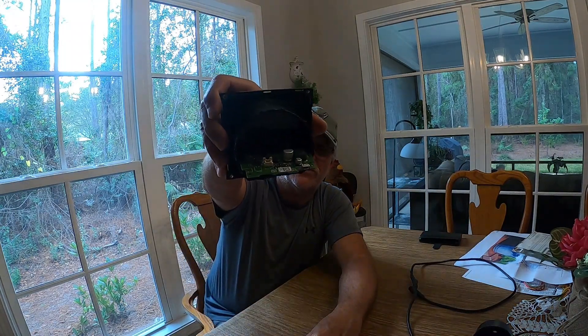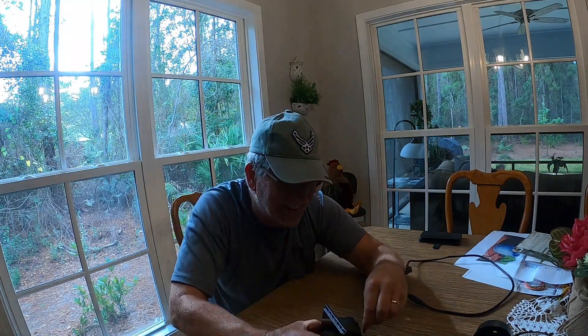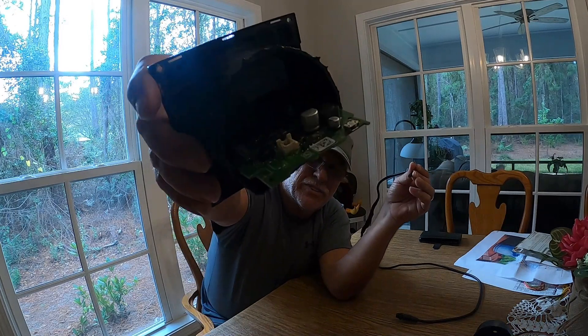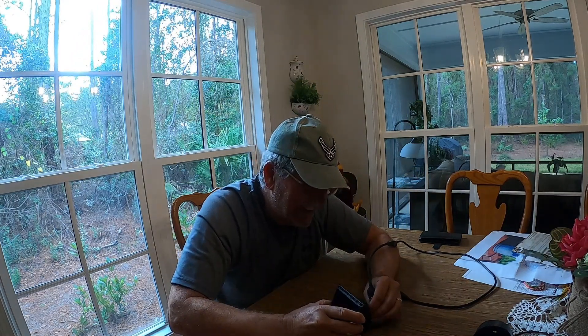Since it's going to cost me $700 no matter what, I wanted to see why it's not working. So I took my Dremel and cut this all very gently all the way around. I couldn't figure out how to take it off the other way and I didn't want to break the ribbon, so I opened it up this way. Inside I found a connector and all the computer stuff inside the Suzuki C10 - it's a little circuit board. You can see there's green corrosion on the pin right in there.